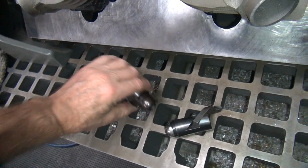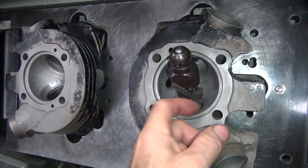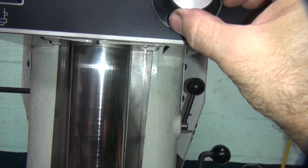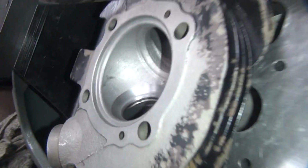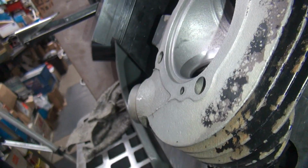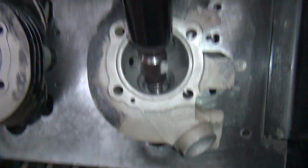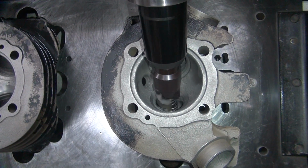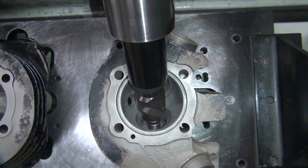So I'm going to go ahead and cut it one more time. This time it'll hold the concentricity better because it's not going to catch on the inside of the hole it just cut. It'll be able to center itself up. Crank the speed up a little bit right there. Gauge that, and turn that on. And we recenter down here a few more times, just to make sure it's on center. Keep dropping a little bit. You hear it coming in.